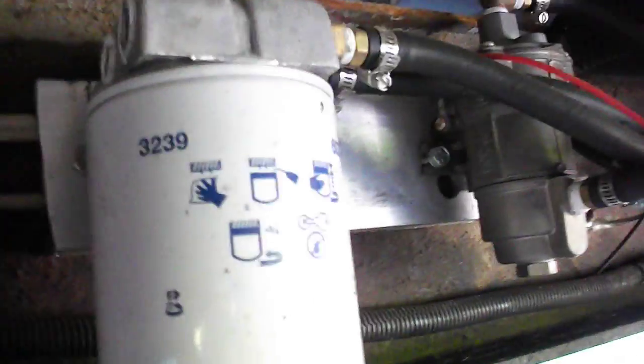For me this is a pure highway queen, so it'll be fine. You can see I mounted the fan on there — that's in conjunction with my lift pump relay harness. I've got it tapped into that. I've also got a transmission oil cooler that I won't show in this video, but it's also powered by that same circuit.